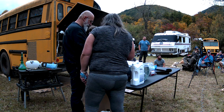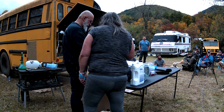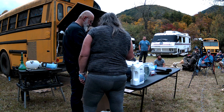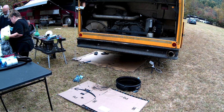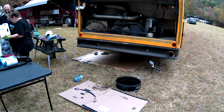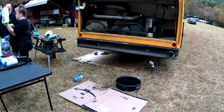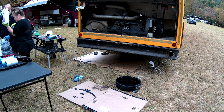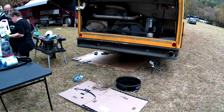Essentially, if your HEUI pump goes, there's a good chance it can send debris downline to your injectors. And if you have a C7, they're $900 apiece. So you'll ruin your HEUI pump and all six of your injectors, possibly. Wow. So they make a post filter called an IFS kit that's manufactured not by CAT, and it's a $900 filter, but it will essentially catch any debris coming from your failed HEUI system before it passes into your injectors or your high pressure oil rail on the top.